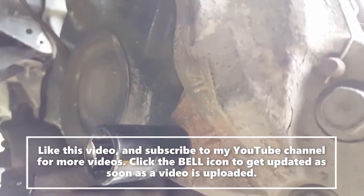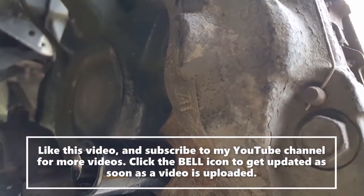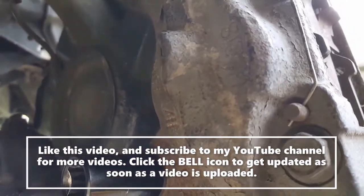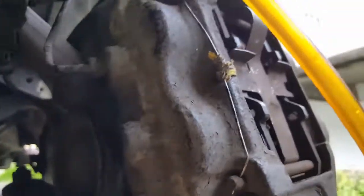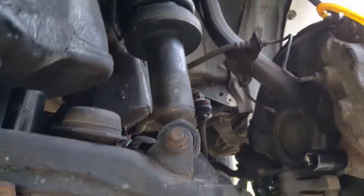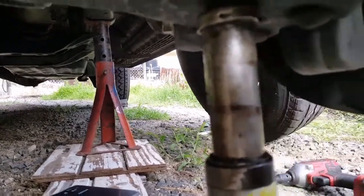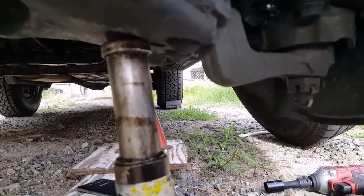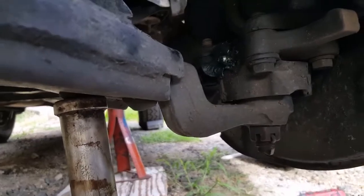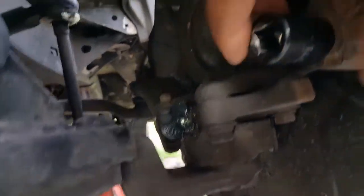Today I'm going to talk about the process I did in changing my front brakes on my 2001 Toyota Surf, and also the wheel studs — two of my front wheel studs were bad. First you have to jack up the vehicle and take out your wheel. As you can see, I have it propped here on the chassis. I still have a jack underneath it and I have the back wheel wedged.